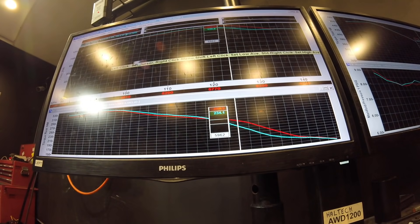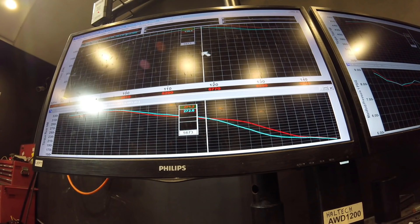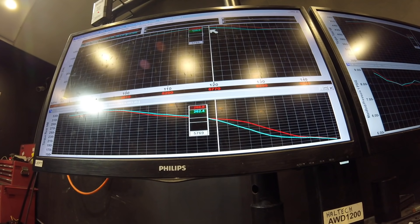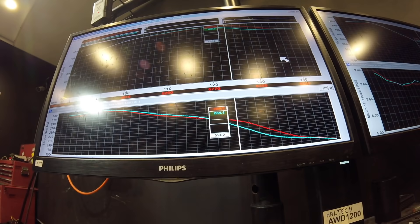Now let's look at that run compared to the last one — it's so arguable. At the top we're losing a bit of power, and that's the belt starting to squeal. It's lost three or four Newton metres from doing that — such a small amount. But it is an amount — we're nitpicking. You put all that work in to pick up 20 kilowatts at the wheels and then you've got to find it again. We've gone from 120 to 128 — eight kilowatts doesn't sound like a lot, but when you've got 120 it's not nothing.